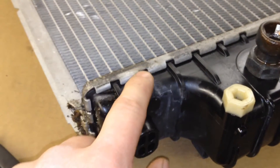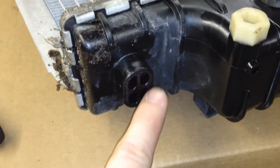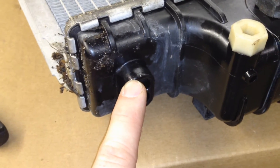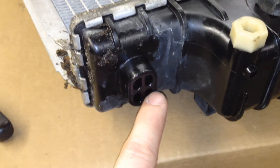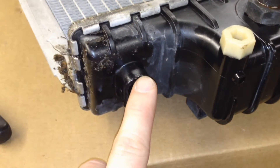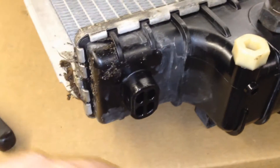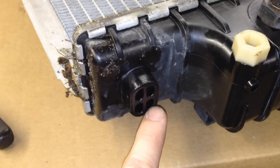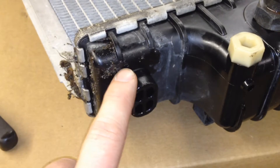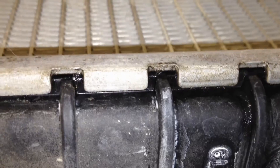When you're looking for a leak on these, you may not see a leak anywhere, but you'll see it collecting around these oval ports down here. You'll see it on both sides where it goes through the radiator core support — it'll just be wet right around here while the rest may look dry. Nothing on the ground, but if this round circle has an oily water-looking residue from coolant, your radiator is leaking from the tank seams and it's just collecting there.